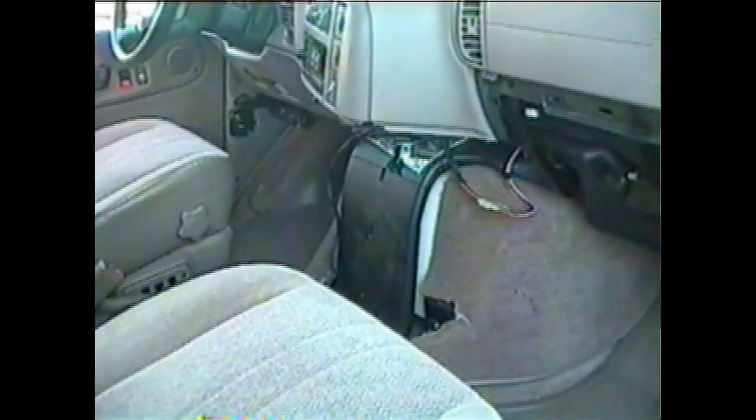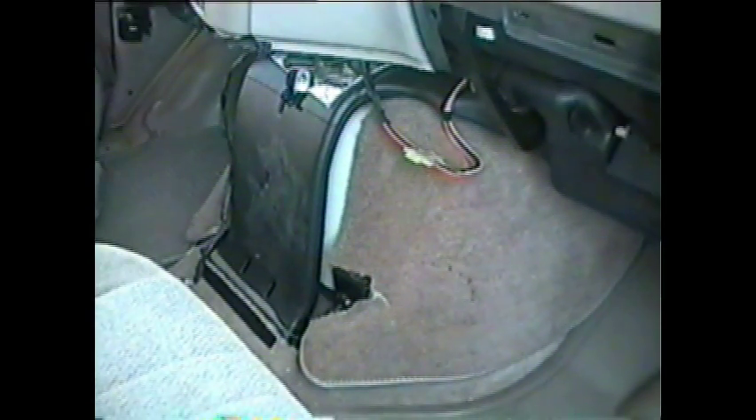I'm working on my Chevy Astrovan GMC Safari style. I've already done a video on how to get the glove compartment and ashtray assembly off the front of this. The point of this one is if you want to remove this cowling because you need to get to the back of the engine — which can be handy if that little vacuum line, that cheap one-eighth inch plastic, finally burns in two and your air conditioner only blows cold air out the floor vents instead of out the top.